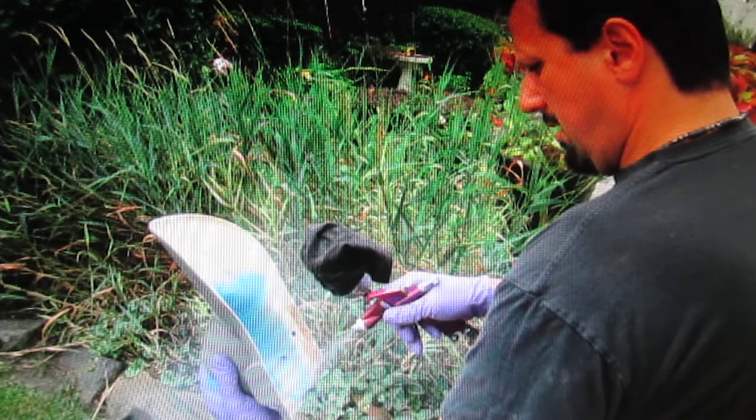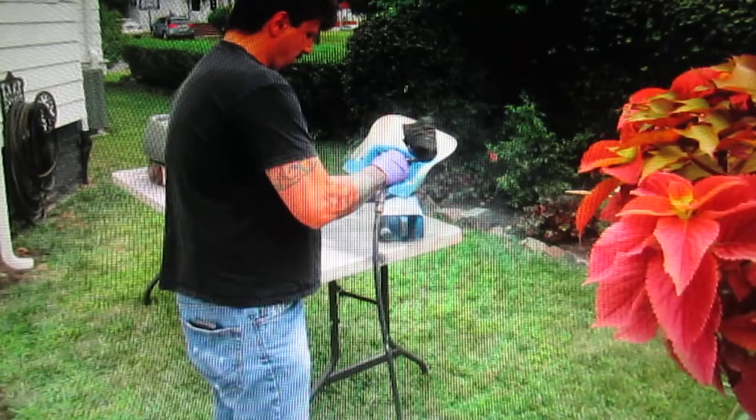Now, even though normally these gel coat parts on the back are all rough fiberglass, we just gave it the slightest hint of a sanding. And then I wanted Glenn, and this is always my technique, to paint the back part first, whether you're painting a model airplane, a guitar, a boat, or whatever. And I've painted them all. You want to start with the back. That gets you a little familiar with the paint. See if you have enough thinner in it, see if it's too thin. And you can set the gun up, set the pressure up. I like to spray with the purple guns, about 30 pounds.